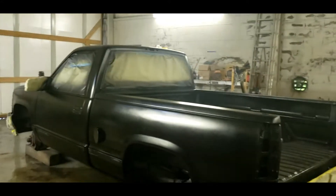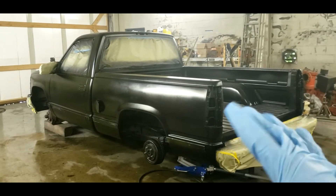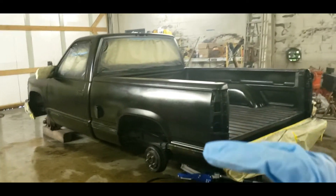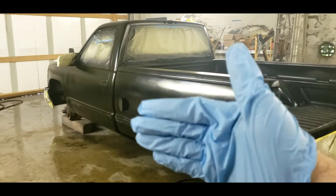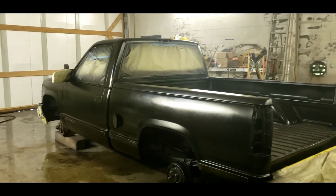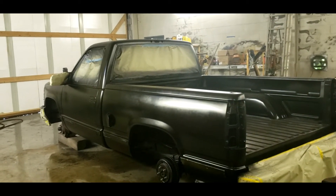When you're trying to save money, the cheapest primer might look the best, but if you get those other layers onto your paint and your bottom layer don't stick, you just throw money out — you have to redo it later. Issues come up. So all that had to be fixed before this truck even got into base and sealer. I actually got more work than I wanted to do on it, but that happens. You can't just act like a Maco and spray it. Sometimes your name is going on it — even though they want to save money, you have to make that sacrifice. Do you want to leave it knowing it's going to come back? Sometimes you make the sacrifice and do a little extra quality work, even though they didn't want to pay for it.